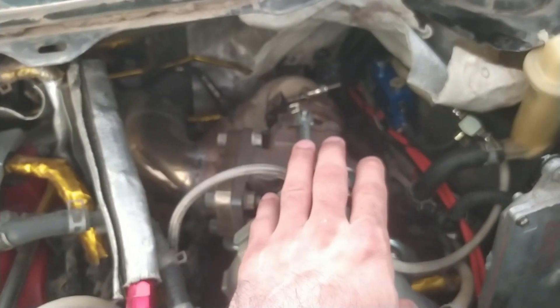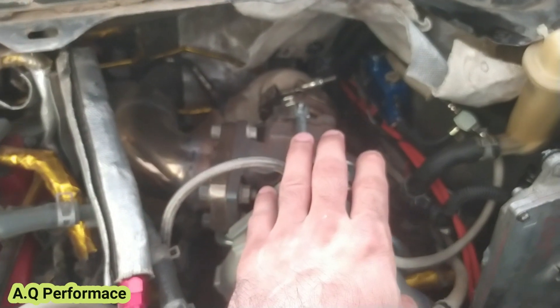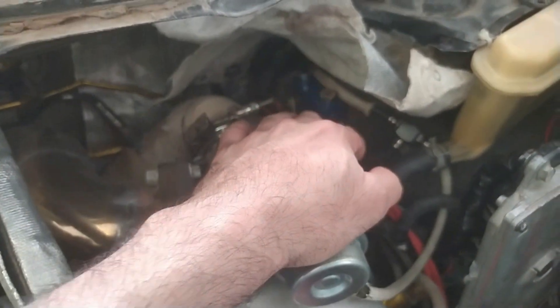The vacuum source location matters a lot. For example, if you give this the vacuum source directly from the turbo, the wastegate will see 9 psi but the intake manifold — due to piping and intercooler lag — will see only 7 psi. But if you give this vacuum source from the intake manifold, the whole system operates according to the intake manifold boost, so your gauge and your computer will all be seeing the same boost. This matters a lot.